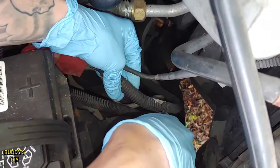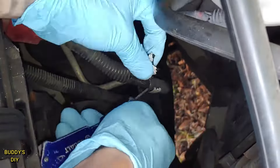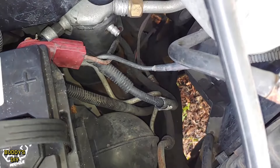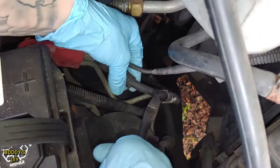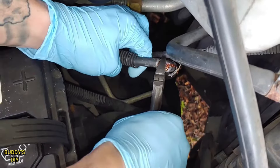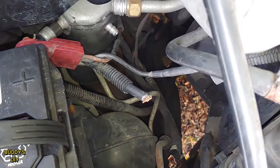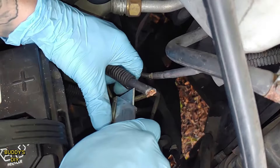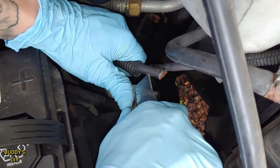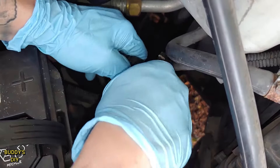So what we're going to do is go down here and cut into this plastic insulation. And once we've got all that cleared away, we're going to take our wire cutters and give a nice clean cut. Now what we're going to want to do is strip away about a half inch of this wire. So we're going to take our utility blade and score around it — it's pretty thick insulation so it might take you a second.